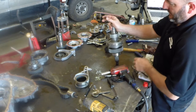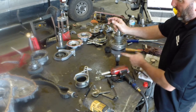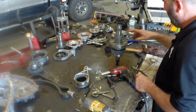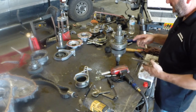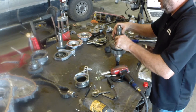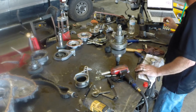Output shaft bearing is installed and I've done the inspection procedure for the chain drive gear. Now it wants me to put the hub and lock ring back on — I don't understand why you'd remove it unless you were going to replace the hub, but I'll throw the lock ring back on. Now we're down to putting the shifter back in the case.